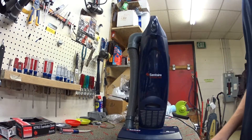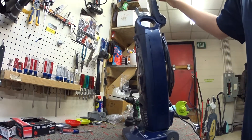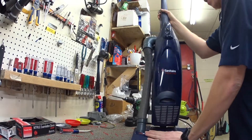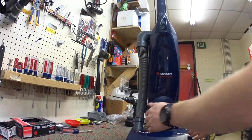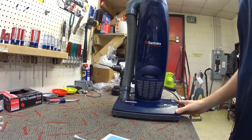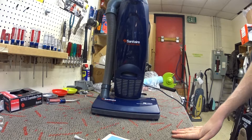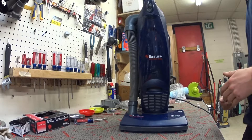It's kind of a quirky machine. These products start in the 90s — it's got a folding handle, a full bag check indicator, it's two-motor bypass, has a lifetime belt, does not have a swivel neck though, and it's got a very narrow cleaning path. What makes this machine relevant now is that it is almost the same size and shape as a shark vacuum, but it's bagged, so it's a lot more efficient, a lot less money to run, and it is much higher quality than a shark vacuum.